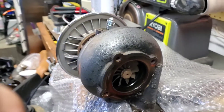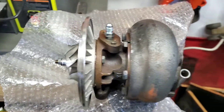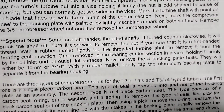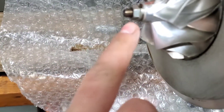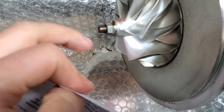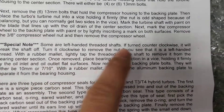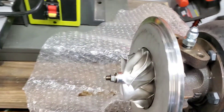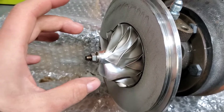Now I have the turbo on the bench — you can see the oil on the backside. I'll put it in the vise; it's cast iron so it can handle it. Start by marking everything like the directions say and making sure it's all straight. It says some are left-handed threads — if turned counterclockwise it'll snap the shaft, so don't do that. This one is left-handed, so I'm going to have to turn it clockwise to take the nut off.